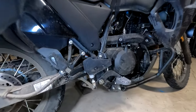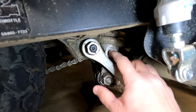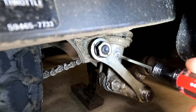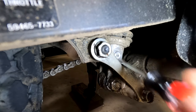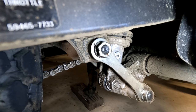Damping is easier to get to. I'm now on the right side of the bike — zoom in — this is your damping adjustment at the very bottom of the rear shock. It's just a flathead screwdriver: turn it left for less rebound, turn it right for more. All the way clockwise is maximum damping, all the way left is minimum. Rebound damping controls how far the shock rebounds when you hit a bump — it's what keeps you from being thrown off the bike. When adjusted properly, hitting a bump doesn't bounce you off.